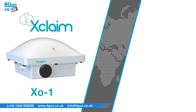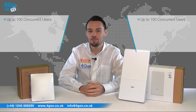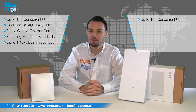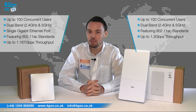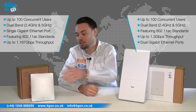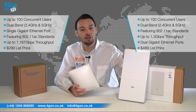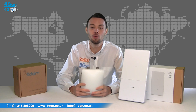So that's the indoor range covered. Let's take a look at the XO1 and the UAP-AC Outdoor, both offering up to 100 concurrent users. The XO1 is a dual-band outdoor access point with one gigabit ethernet port, featuring the latest AC wireless standards and speeds of up to 1.167 gigabits per second. The UAP-AC Outdoor also features dual-band wireless AC, but with faster speeds of up to 1.3 gigabits per second at a range of up to 600 feet, and dual gigabit ethernet ports. The XO1 is at $299, while the AC Outdoor is $489. It will be down to the user to decide whether they need the additional gigabit ethernet port, concurrent users, or faster throughput.